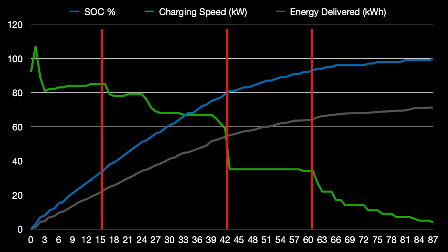If your only option to get to the next charger requires sitting at that 35 kilowatts — for example if you're charger-hopping with the standard range battery — it's not a terrible deal. It'd be nice if it were a little faster, but it's at least tolerable. I definitely don't recommend charging beyond that, to protect the battery, and also because it takes almost another half hour to go from 91 percent up to 100. I took this data in the last month here in 2023 on a 2022 model, so we'll just have to see how Ford revises it over time.